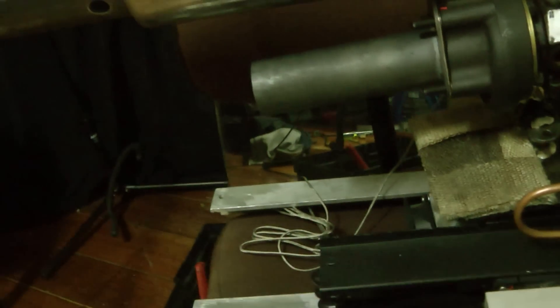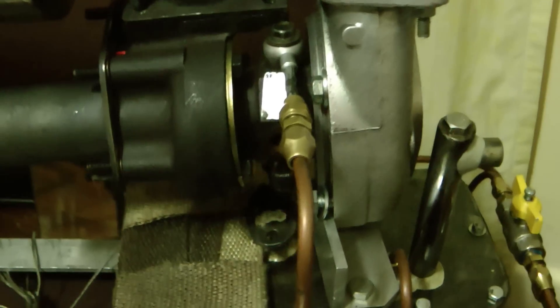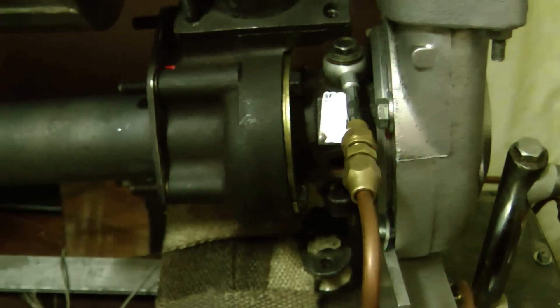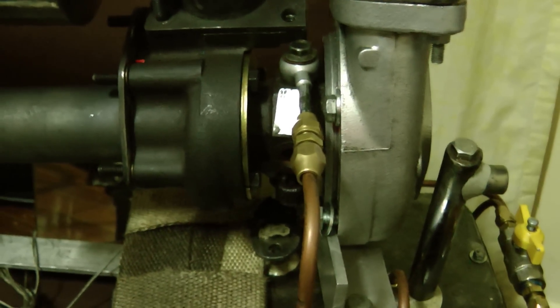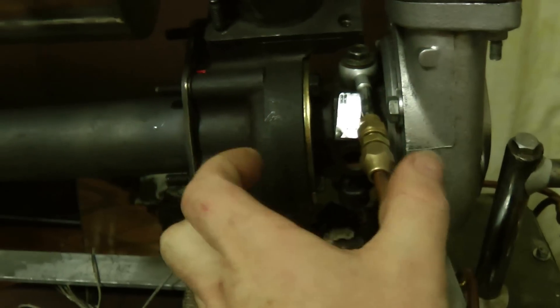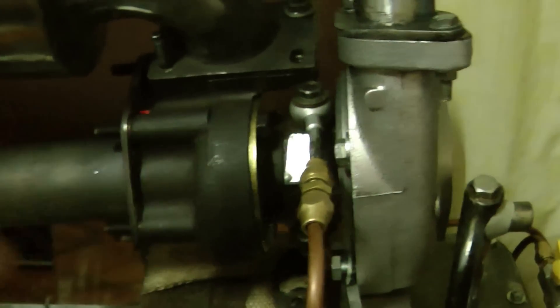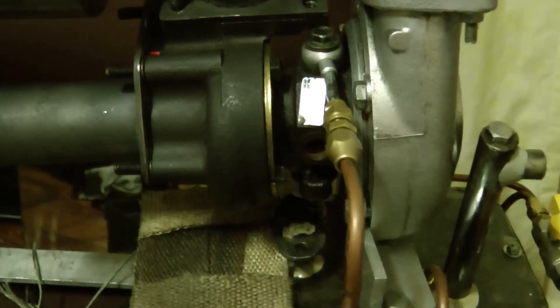That pressure will then be fed into a turbine, which is basically half a turbo. Now, a lot of people — you have to run 60 pounds into your turbo. When you're running a turbojet, there is a huge amount of continuous pressure — it's not a fluctuating pressure like in a car. A lot of people say run about 40 or 50 pounds. You've got to think of the poundage, the pressure that is actually pushing on the bearings inside. They're not ball bearings — they are what they call a wet bearing. You need to keep the pressure up to the wet bearing. Even if it's running for a couple of seconds without oil, that's enough to destroy and unbalance the turbo.